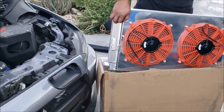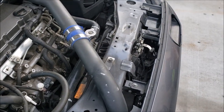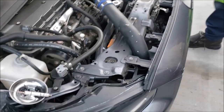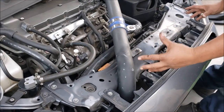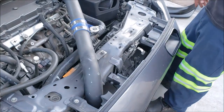As far as accessing this radiator — because it's pretty hidden — what do we need to do? The whole bumper has to come off, which I'm working on. And then the top radiator support comes all off. Then it comes off. I'd say two days from now I should be ready to go.